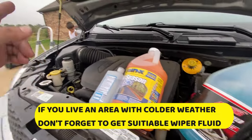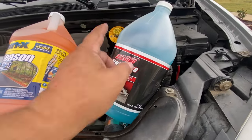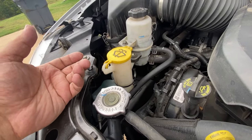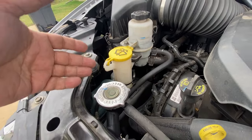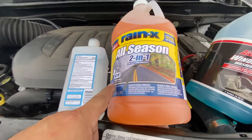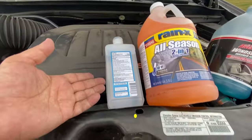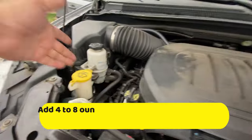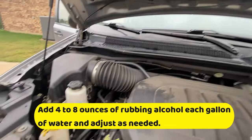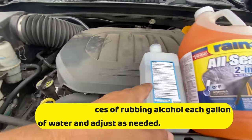The last step for an area with cold weather is your windshield washer fluid. This one is rated for 32 degrees, so it can actually freeze. When it freezes, the liquid will bust the container — it's an expensive and nasty repair that requires getting underneath the vehicle. To avoid that, switch to an all-season two-in-one that can go down to zero degrees. But if your fluid is full, you can throw in a little rubbing alcohol to keep it from freezing without having to dump all that fluid and possibly clog your jets.